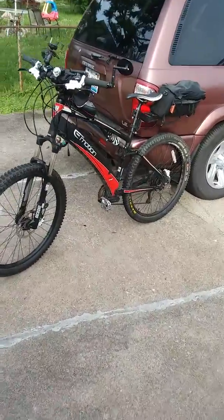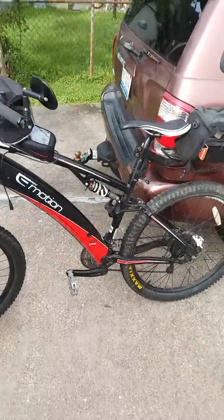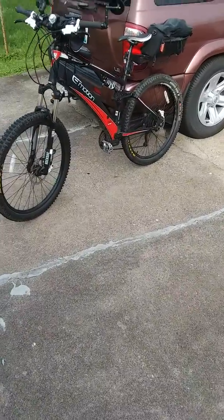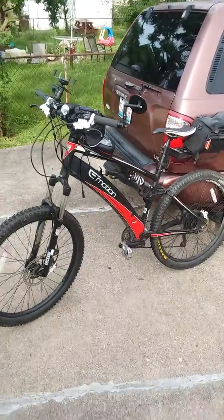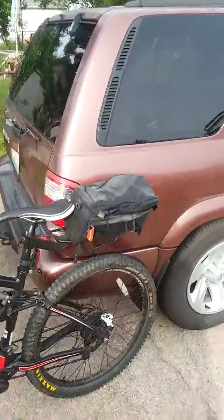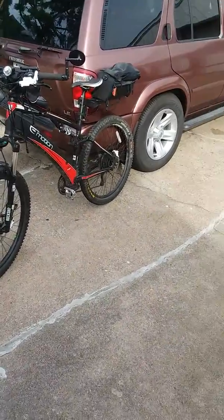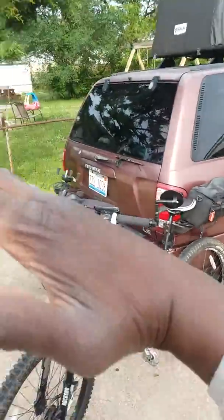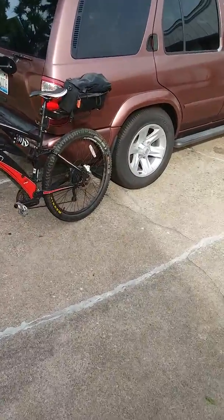But you know, these bikes are so cool. Every bike that I have has a different purpose. They're not all the same, and that's the fun part. Like I've got the 20-inch Easy Motion Neo Prox. Yes, I'll do a review on that again later. If you look at my older videos, I have done reviews on that. That's a 20-inch electric bike, and it has the exact same motor. But the difference is the torque generated in the wheel is a lot more than in the 650B wheel. Why? Because the circumference of the wheel is smaller. Therefore the motor doesn't have to work as hard, and you have more torque. I can climb real long, steep hills at like 10 miles an hour with that bike because of the smaller wheel size.